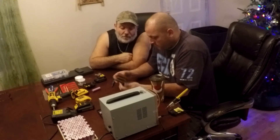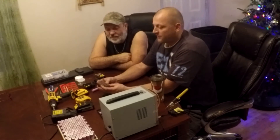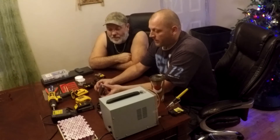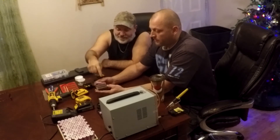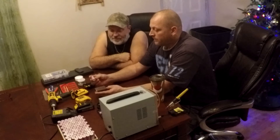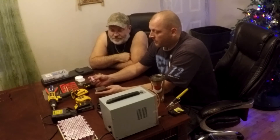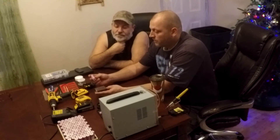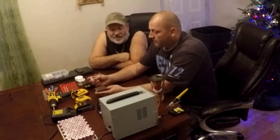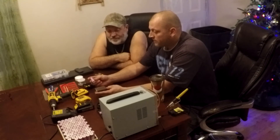I think we're lucky — oh, look at that, that came out easy. So this is going to be a lot easier than planned. There's a really good example of how these batteries are identical — these ones are from a laptop. This is an old laptop battery that had six cells in it, and it was likely that one or more of the cells was failing. For that reason, the charging circuit wasn't getting up to the proper charge voltage because that one cell was holding it back. The laptop's BMS is smart enough to know the cell is damaged and it won't continue to maintain that battery — one cell's dead, the total voltage isn't enough, so it stops working.